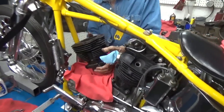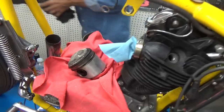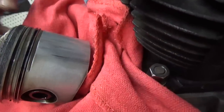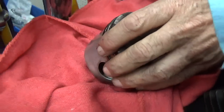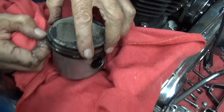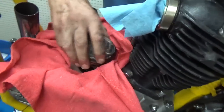Let's take this off slow and easy. Once my hands are clear of that, we'll take a look in that cylinder in a couple minutes. The other thing is, if for any reason the gaps in the rings line up with each other, then you've got a passage for oil to go through. They're supposed to be staggered — and they are, but not the way I would do it. It doesn't really matter what I would do now.